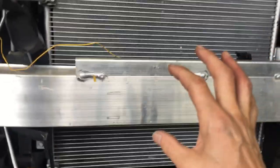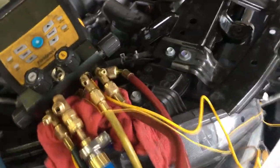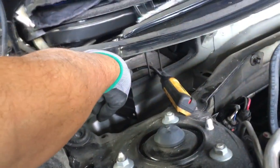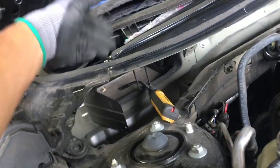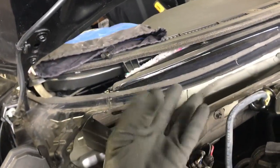That takes care of that. I showed you where you're getting cheated when you buy some of these aftermarket condensers — you really have to be careful. I showed you my pressure testing method for this YF system using 150 psi. You've seen my leak detector, my electronic one, and I put UV dye inside them. You could see where the best place is to take your air temperature measurements, and actually it's better if you can get on the other side. You could see the cabin filter, the top before it goes down and drops into the spinning squirrel cage fan before it's forced into the evaporator.